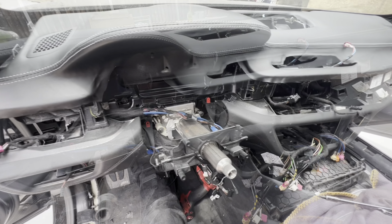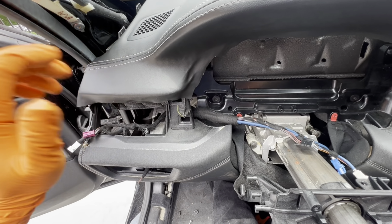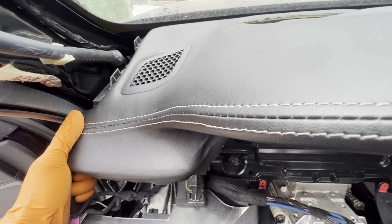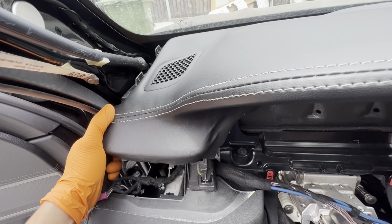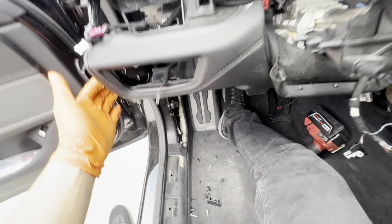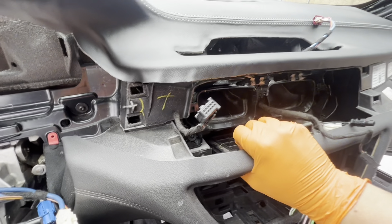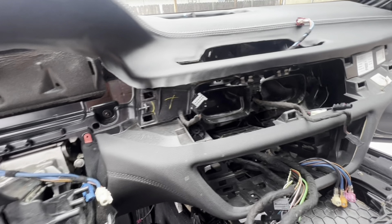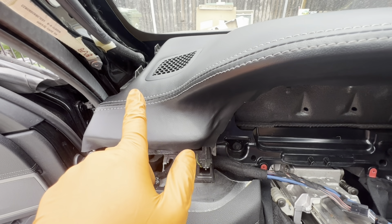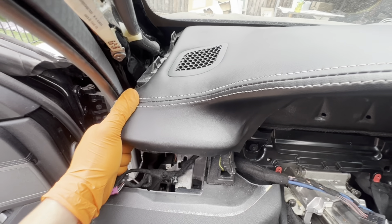Got most of the screws back on. A tip: once all screws are in, grab the panel and give it a good shake — you'll hear any loose screws as a tapping noise while driving. I know I missed one screw in this corner — wanted to demonstrate this technique. Shake here, it's nice and quiet; if you're going to get a rattle you'll hear it. This is a great indicator, so tighten anything loose and recheck. Perfect.